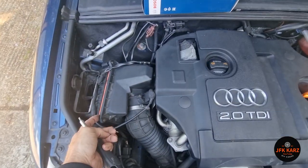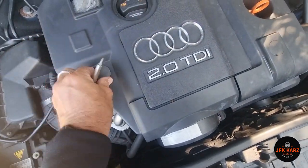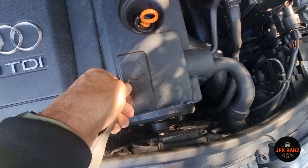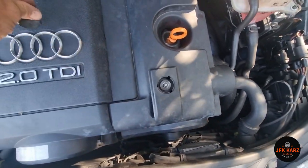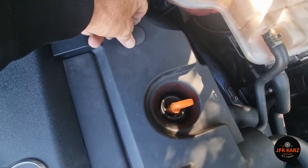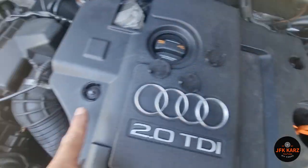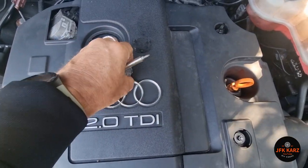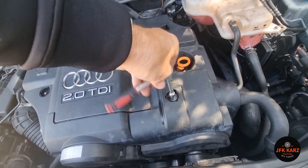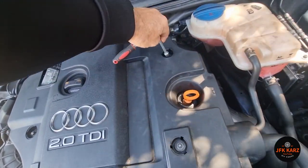In order to give you the leverage you need to open this up, you'll have to remove this engine cover. You've just got three little plastic caps to remove, and then there's going to be a 10mm nut underneath. A bit of a pain really for a little silly job, but there you go. Take those nuts off and then you can remove the cover — a little 10mm socket wrench under these little nuisances.